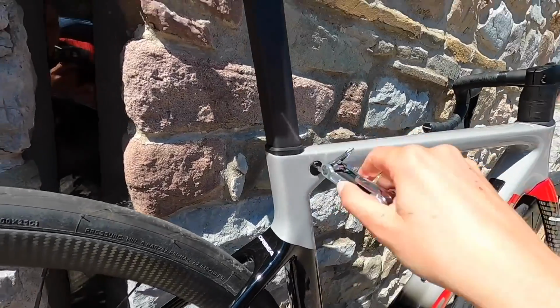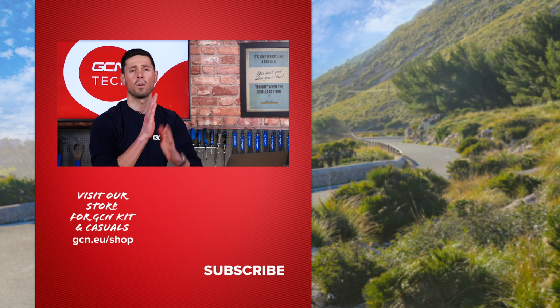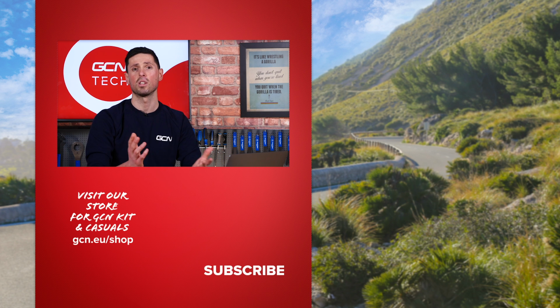One thing it is important to note is that when you're changing the saddle height, it will have an impact on the setback of your saddle, because obviously the seat tube is at a slight angle. As you put the saddle up, it's going to shift the saddle back slightly, so it's worth checking that as well.